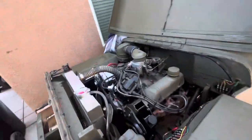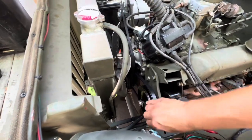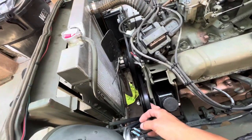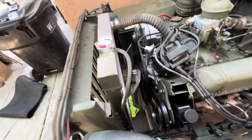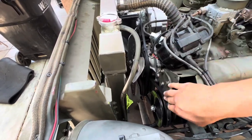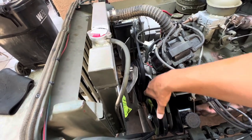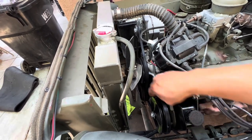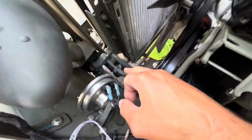Got my extra pulleys that don't work. So what I ended up doing, I got that double pulley in there with it spaced in the back, and the lock nut on here. I put the tape measure around this area, and I got a 40 inch measurement. So I went to the auto parts store and got a belt for 40 inches. I got it on there, got my hoses installed here.